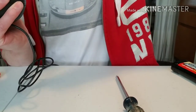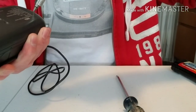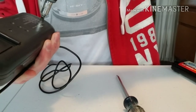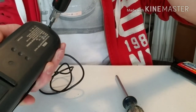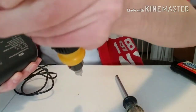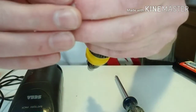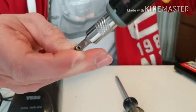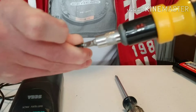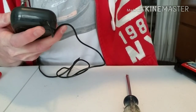This is where you need the spanner bit. It's a pain because you have to put it right in the center, push down, and unscrew. You may jack up the edges a bit — there's no getting around that, unfortunately, just because of the width of the bit. The next size up wouldn't fit in the hole. The screw basically looks like a straight bar, and the spanner bit just goes inside it — it doesn't go all the way but it's good enough to unscrew.